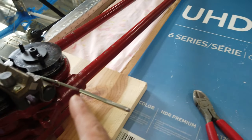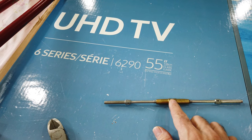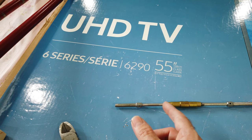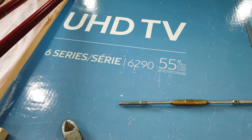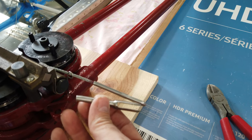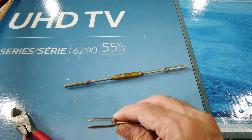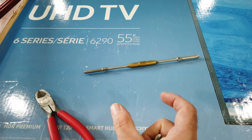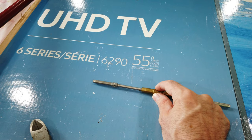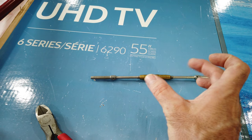I know cutting the cables will make them shorter, but when I go to splice the turnbuckle in, I've got that entire length of turnbuckle to work with to get everything correct. So I'm very confident I can cut these ends off, put the forks on that I prefer, and have the forks attach directly to the pedals without any kind of a metal extension between the two. Then I'll splice the turnbuckle in and use it to fine tune the tension on the cables.